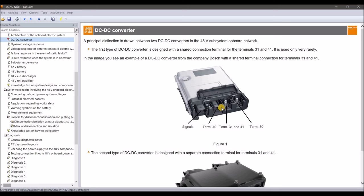This is somewhat similar to the high-voltage interlock system. At the high-voltage system you have three relays; here you typically just have one power-plus relay at the 48-volt battery. Also, as far as is known, no capacitors are used in the 48-volt system, so you don't need to worry about discharging the system — active or passive discharge is not an issue here.